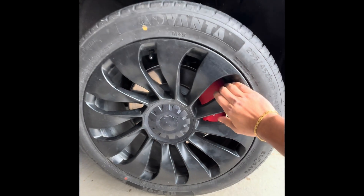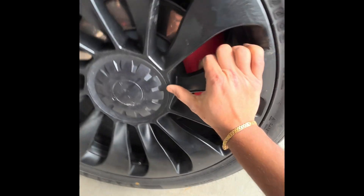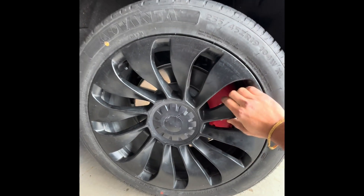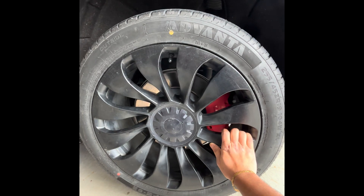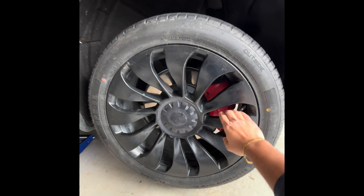It's kind of hard to rotate — generally it should be very free, but it's very hard. I'm going to try on another wheel to see if it is smoother. It's kind of hard to rotate; I'm suspecting the ball bearing has gone bad. I did order one from eBay — it's going to arrive in a few days. It's hard and it's making noise.